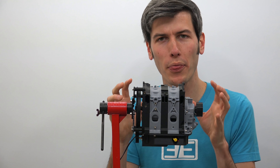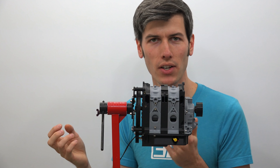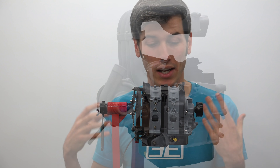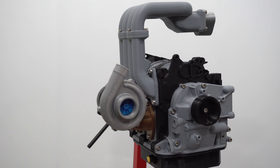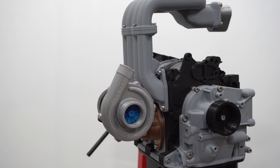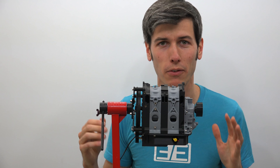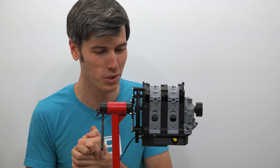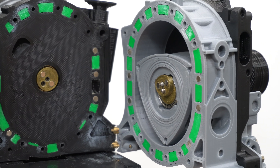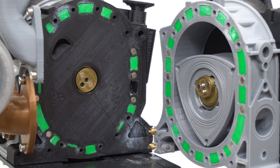This particular model is a one-third scale 13B REW engine. It was used in the Mazda RX-7 between 1992 and 2002, and it was actually a twin turbocharged engine — it had twin sequential turbos, so there's a turbo that attaches right on there and another one as well. This engine actually produced about 255 to 280 horsepower, quite impressive coming out of this 1.3 liter, especially when you consider the size. This thing is only about one cubic foot in volume.